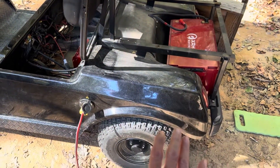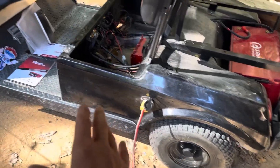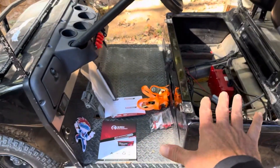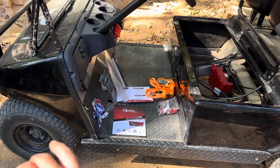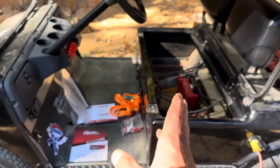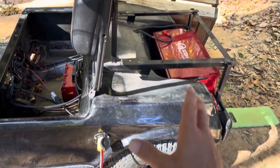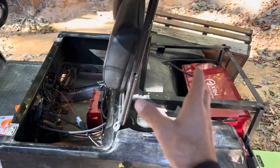The tires slide now when you put on brakes going down hills — there's not enough weight. I lowered the tire pressures way down; I was running right at 10 pounds and I'm down to about 4 pounds in all tires. The steering is super light now — used to you had to kind of grunt on it with all that lead acid weight. As far as climbing hills, the front end can get a little light — you could almost slip a playing card under the front tire if you nail it from a dead stop. It'll almost wheelie with just an old series DC motor — pretty impressive.